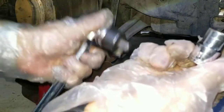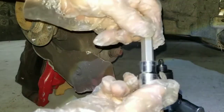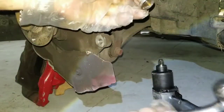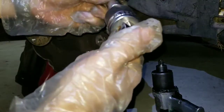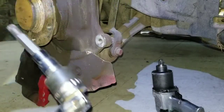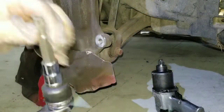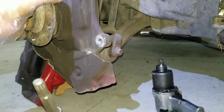I'm using a half-inch socket to put this in there. I'm gonna use this kind of ratchet or breaking bar. Don't use a gun because you will end up drilling it out, and it's not worth it.